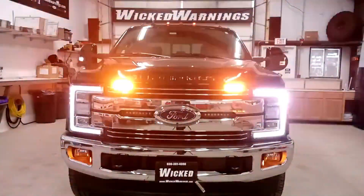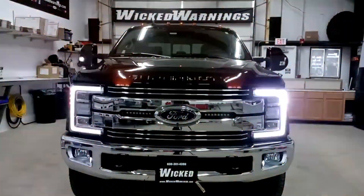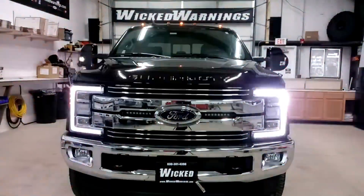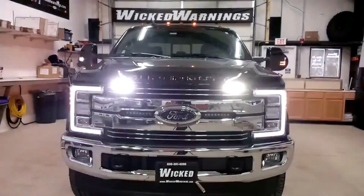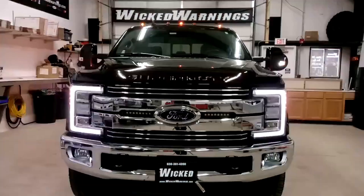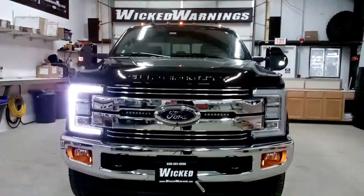Now that we have the flood mode off, I want to show you a closer view of what you're going to get with the parking lights on with the auto flasher for the C-rings. As you can see, there is a bright and a dim level to the C-ring. The dim level comes on as a parking light; the bright level comes on during the day as the DRL. The bright level is what the auto flasher will modify — we advise using the DRL line. So when you have the parking lights on you'll get a bright-dim-bright-dim flash, and during the day when parking lights are off you'll get a bright-off-bright-off flash, just like you can see here.